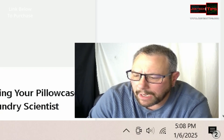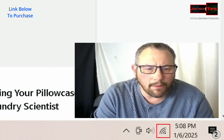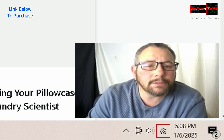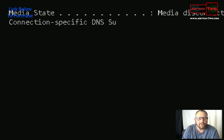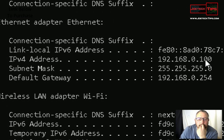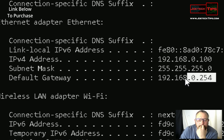Let's see what IP address we have received. I'm using a wireless adapter on this PC for internet; however, my hardwire connection is connected to this device, so I'm going directly to the Ethernet. When I type in IP config, we're looking for the Ethernet adapter — and the default gateway is this.